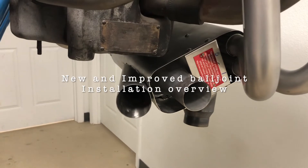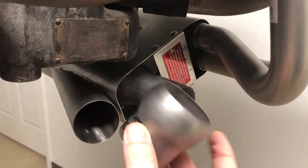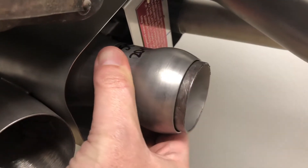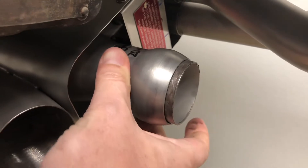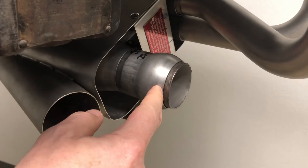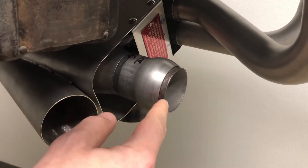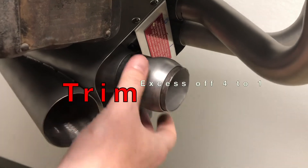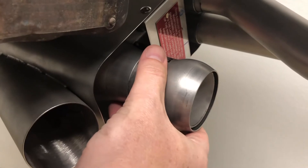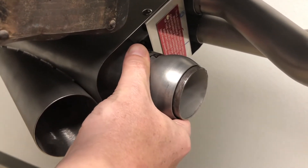Here is a four-to-one that we are modifying to put the intermediate tube on. This is the ball joint and it has to be slid over the four-to-one, but as you can see it has to go all the way down — that's in our instructions. The ball joint is too short for the four-to-one, so this excess must be trimmed off. Once it's trimmed off it's going to look at least like this — it just cannot be above the ball joint, because that will prevent the ball joint from working.